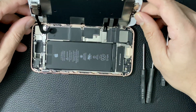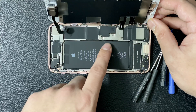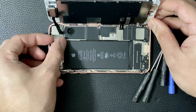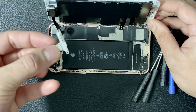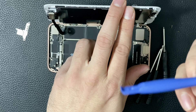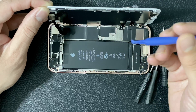You can see two ribbons here. We have this one where the proximity and camera sensor sits, and then the battery and display ribbon right here. There are three screws right here — you want to take those out, then take this cover off. Once that's off, you'll have the proximity sensor ribbon right here where my finger's pointing. You want to pop that up using one of these tools that you can get on eBay when you buy screens or replacement parts — check out the link in the description.